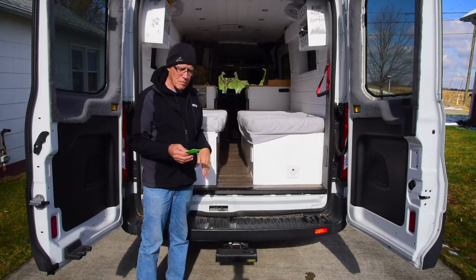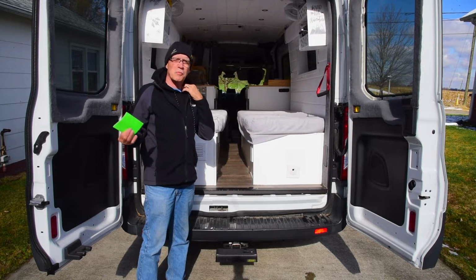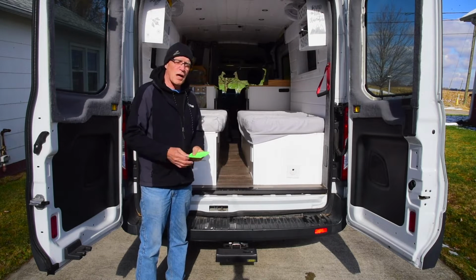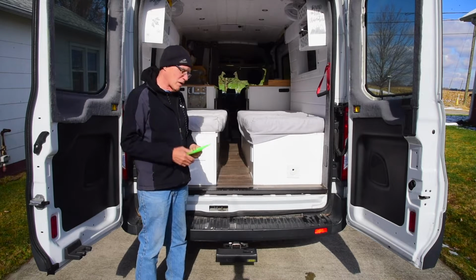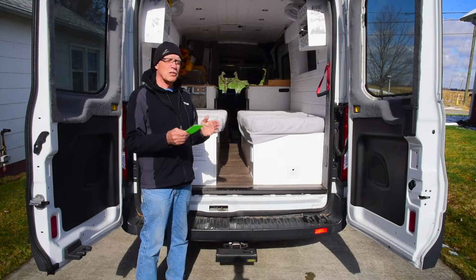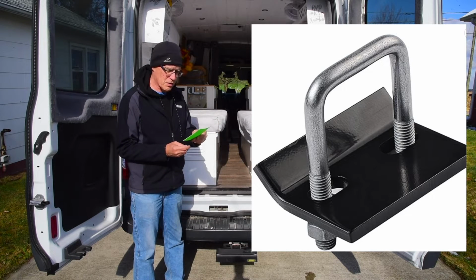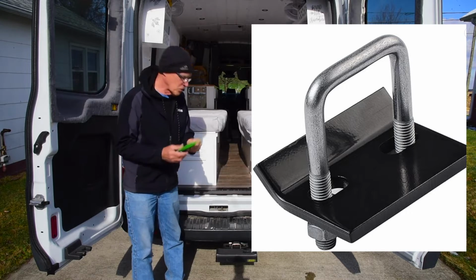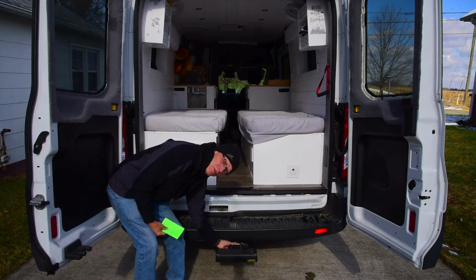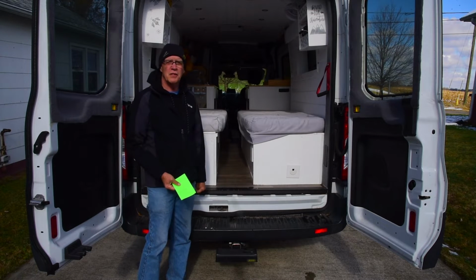And the other thing I added, and I'd known this before when we had a small camper, even if you can tighten everything down, it can still rattle if you've got a trailer or a camper or whatever, or a hitch, any kind of thing in the hitch, it's going to rattle. So I have an anti-rattle stabilizer made by MaxHaul. It's a 50023, and it fits in here, and you'll be seeing a close-up, but it's a way of tightening up, and then just a regular pin that fits in there.